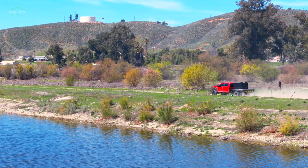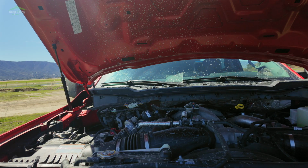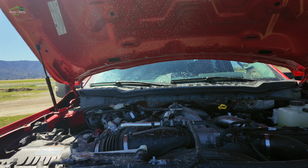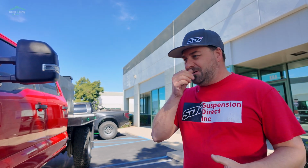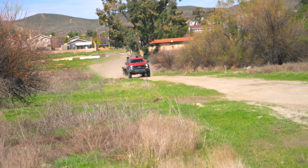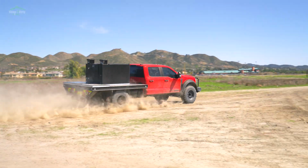Anything else we want to call out here before we move to the back? They have some ignition stuff that changes the way the transmission works, changes the speed. You've got to think, these tires, I think stock is 31.9 and now we're at 41 inches. So there is a lot of difference, and I know that they have a controller to help do that. So when they do this kit, it's not just suspension. There's also some reprogramming that has to happen to really manage the power better, right? Because these are set up for towing. They're not set up for speed.